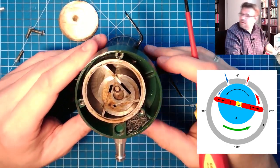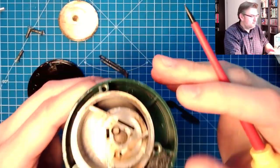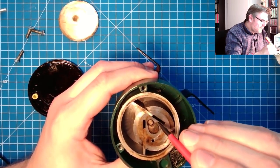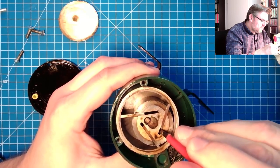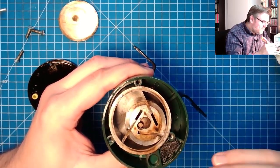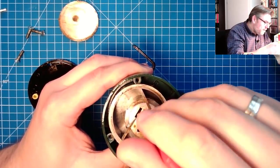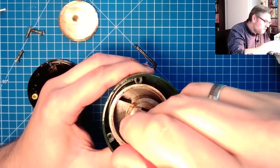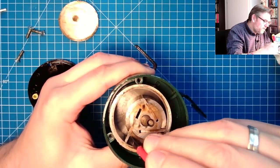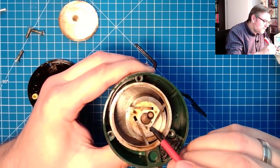Here's the intake. I'm not sure if you see this, the hole of the intake is here. See this? There is the hole of the intake. So here it will suck in air, then it will turn further. This is going to get out. Will turn further. And then we have this and the exhaust point is there. Here is another hole at this position. So we will simply shift all the air out, compress it, because you know it's eccentric. Compress it and push it out here. And here suck in the next one.